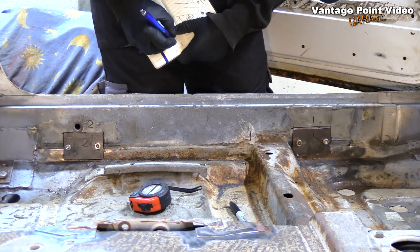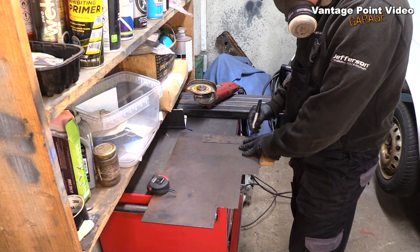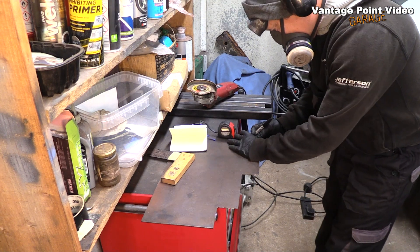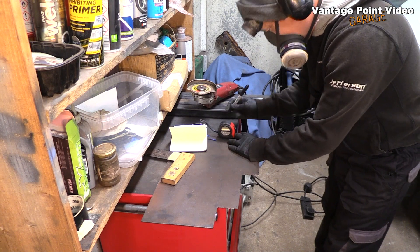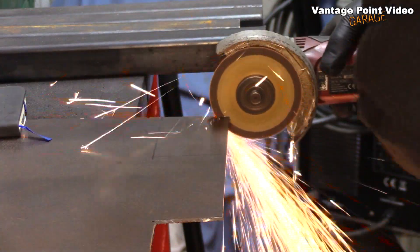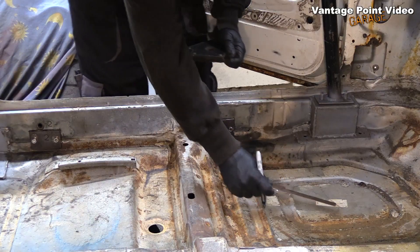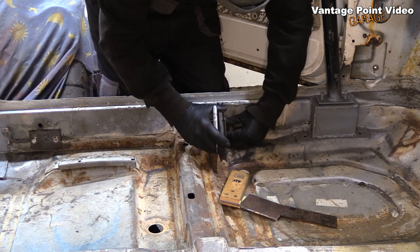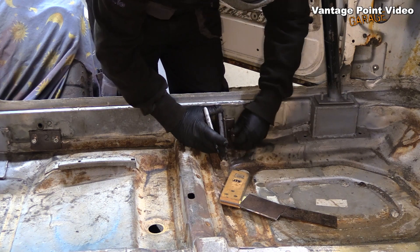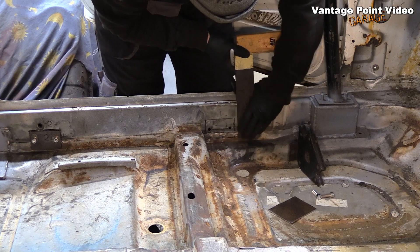I'm taking measurements for each individual plate that I'm going to have to make. They're all going to be different because there are different factors affecting each one. That one is really close to the original cross member in the car, so the end plates are as near to the back of that plate as possible. The guidance from the regulations doesn't actually give dimensions for the counter plates - by logic they just have to be bigger than the 40 square centimetre end plates. I transferred my dimensions onto my sheet of 3mm thick steel and I'm cutting them out. These plates could have been 2mm thick according to the regulations, but I might as well continue working from the one sheet. This design is allowing me to put a bit of strength into the shell low down and I'm happy to maximise that rather than work to the minimum.